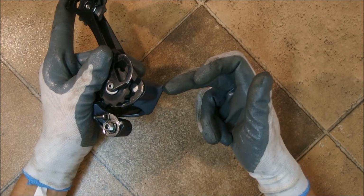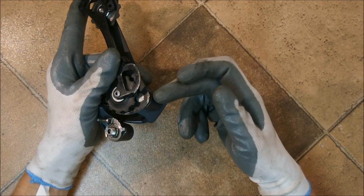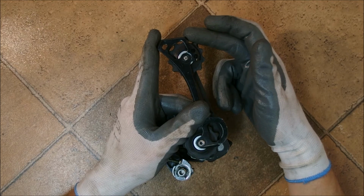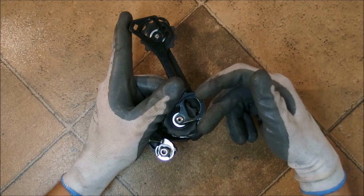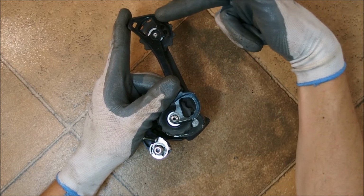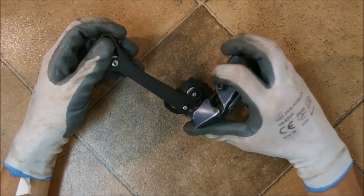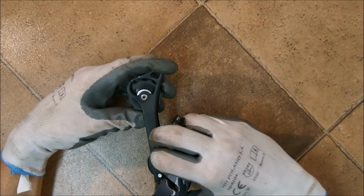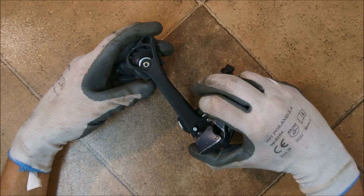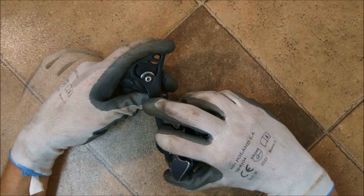If there are, say, 3 possible versions of the derailleur, the one with the shortest cage will have the same spring here as the one with the longest cage. However, a long cage is obviously a long lever. So, because all things are constant, the long cage has the least amount of force here that tensions your chain. This is important in mountain biking because when you're riding over rough stuff, the long cage derailleur will offer the least security of your chain, which is very annoying because it can end up with a derailed chain or the chain jumping over the cassette in a random manner.